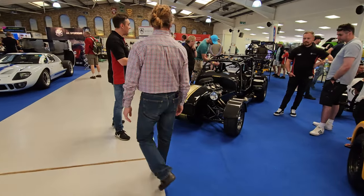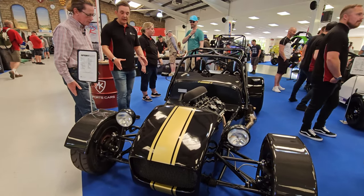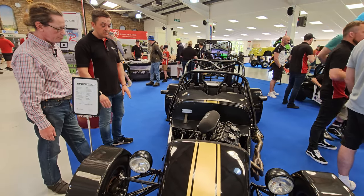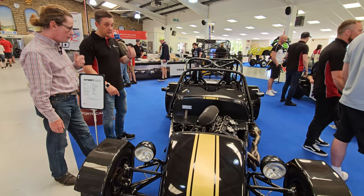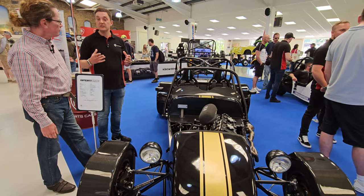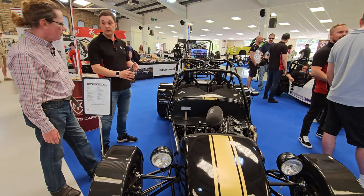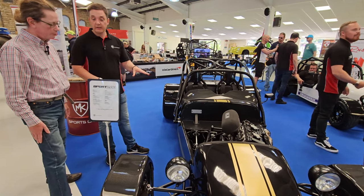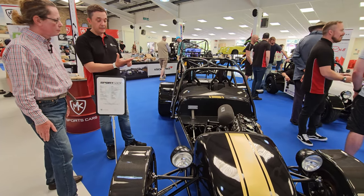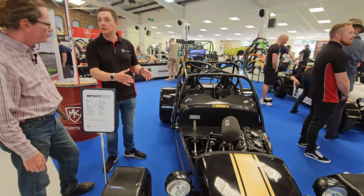If you don't want a car engine, we've got an alternative — and this is where we're quite unique in the marketplace. We do the bike engine. This is the Sport 200 — 200 horsepower — running a Suzuki Hayabusa engine with our own billet uprights on the front. This particular model has an aftermarket Life Racing ECU, which monitors everything on track and will cut the engine if it detects oil pressure loss. We've also partnered with RLM Racing and have a billet sump — a wet sump system, so you no longer need a dry sump setup.